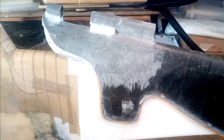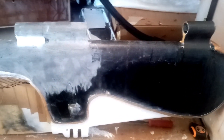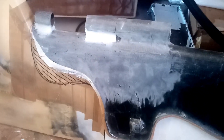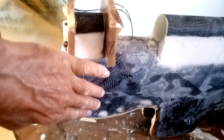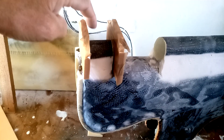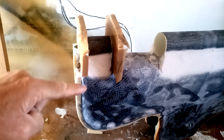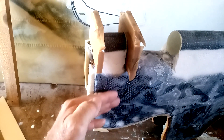I've put brown tape on the rudder blade and put the housing over it, because there needs to be more grip for the bottom rudder hinge on this rudder house. We have changed the position of the hinges in the new extended stern. Bending a piece of foam and gluing it on will give us a nice edge to work the carbon fiber against. With paper tape we've closed off the pipes to stop epoxy from coming in. We've made our foam borders and we're now going to put carbon fibers in between. All the fibers need a good surface area behind there to hold on to, else it's just going to rip itself off the new rudder house.